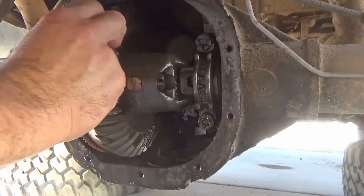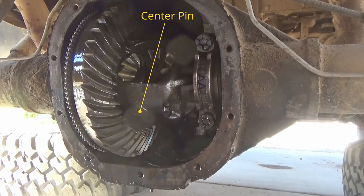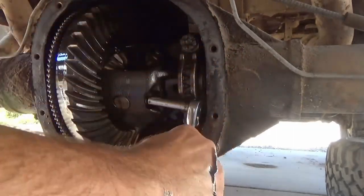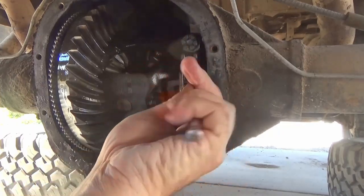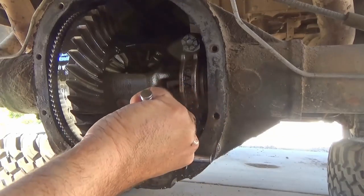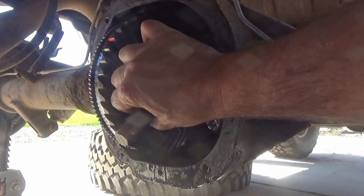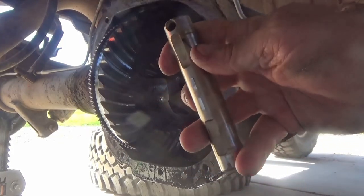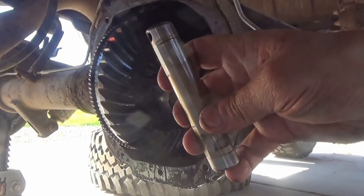At this point, rotate the carrier and you'll find a center pin retainer bolt and a center pin. Remove the retaining bolt first — you'll probably need to support the pinion with a screwdriver to keep it from spinning while you loosen the bolt. Be careful, because once the bolt comes out that center pin can drop right out. If it doesn't slide out on its own, push on top of the pin from above the carrier and it should slide right out. Upon inspection, you can see the axles have actually worn grooves into the center pin, which could have caused side play in the axles.